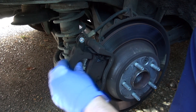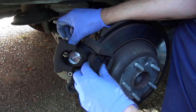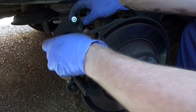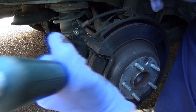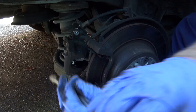If you just take a screwdriver and pop it underneath here, the caliper just comes away like that. There we are — one caliper off. And here are the brake pads, which can easily be knocked out. There's one and there's the other.